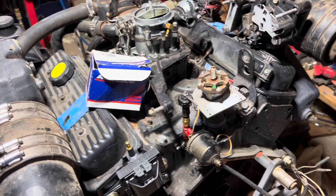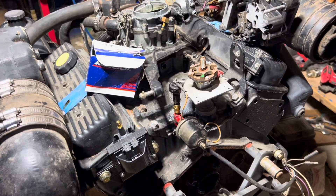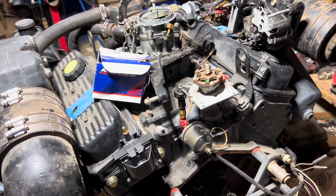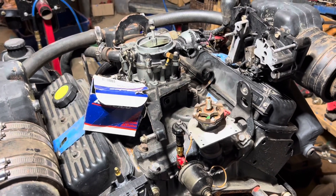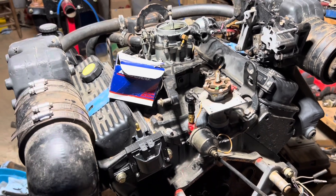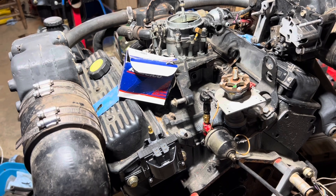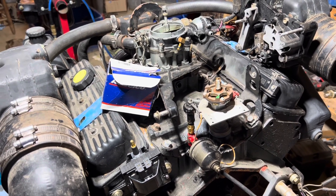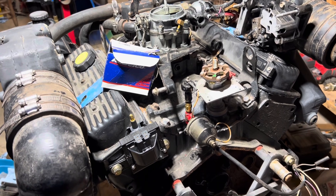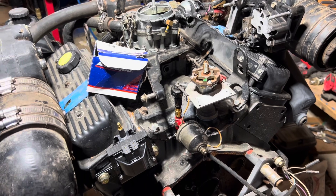Hello, welcome to another video by Moxa Marine. In this video I am installing a Delco EST ignition system on a MerCruiser 4.3 liter V6. This engine is a pre-Vortec, probably somewhere between 1990 and 1995. It originally had the MerCruiser Thunderbolt 4 system, and every MerCruiser engine I build I go ahead and upgrade them with Delco EST parts.